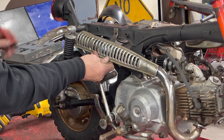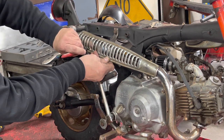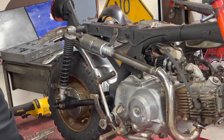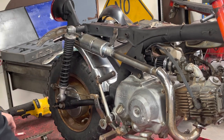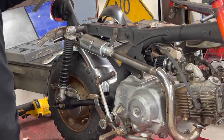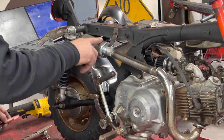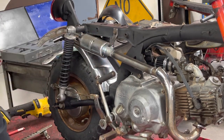So what I'm gonna have to do is try and weld a couple nuts right there, but then I can stick a short bolt in to hold that. This side, the front, has the clamp that goes around it, so that'll be good. So I'm gonna have to turn my welder way down because this muffler's not very thick. I had to patch a little hole right there where I had turned up too high and blew through it, so.